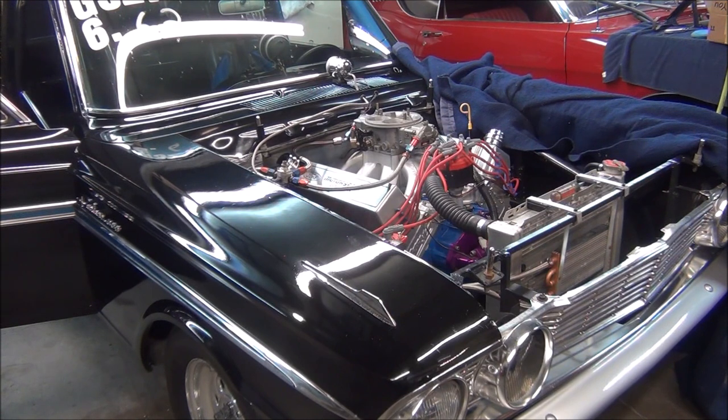My fuel pressure was way too high, but after using this later style diaphragm, because you can't get the original diaphragm for this regulator anymore. If I don't like how that works out, I may have to buy a new regulator later on, just because they discontinued the original diaphragm for this regulator. But I followed their directions. It's supposed to work. I just had to adjust it way out compared to where I had it. What used to be 7 pounds was like 14 pounds, which is way too much.